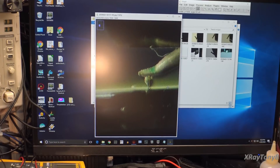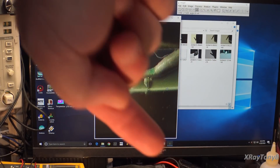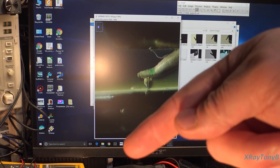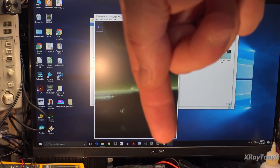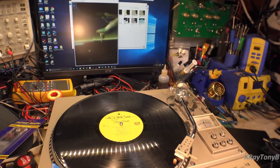That looks pretty good. If it were not correct, we would have to shim the back of the cartridge a little bit to give it more of an angle. But luckily I think this will work just fine. That's how I do it. I really don't know how you'd do this without one of these microscope setups - this is something new for me. I've never tried to do this before - I always tuned by ear. My main turntable upstairs is a Pioneer PLX-1000 and it has a deck that goes up and down - you can rotate it to raise and lower the arm and change the rake angle directly from there. I dialed mine in by listening.